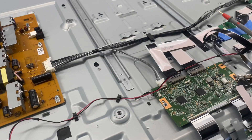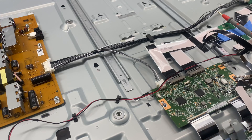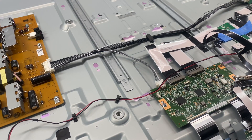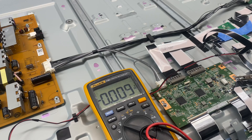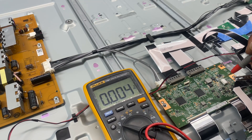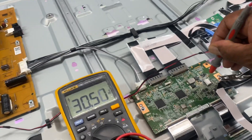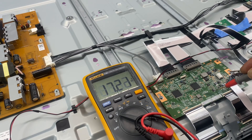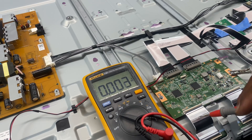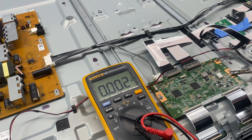When we last checked with both ribbon cables connected, our voltages were gone. So let's plug it back up and check. I want to check the 30 volts — VGI or VG — and I have 30 volts. If I go to VAA, I get 17. And that's with this cable connected. It's telling me I have 10 volts. And let's see — I got 6.9 volts, actually 6.9 now instead of 6.7.